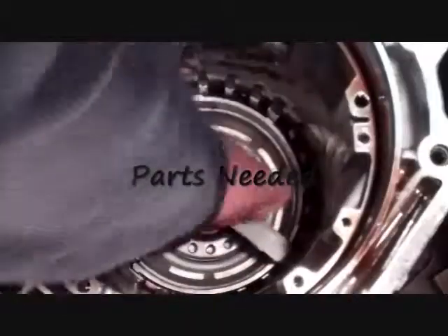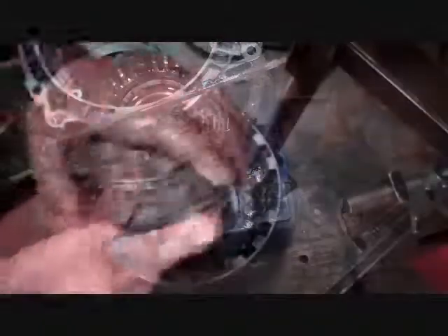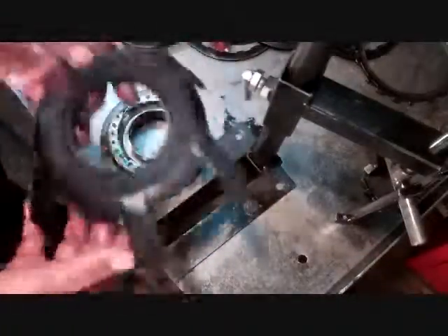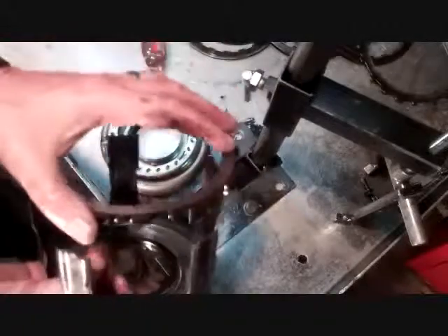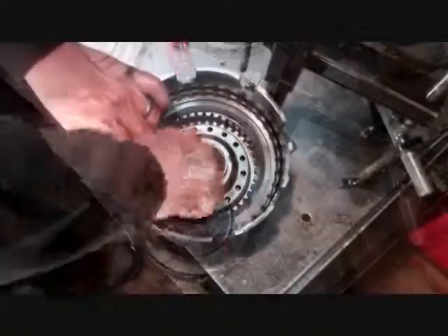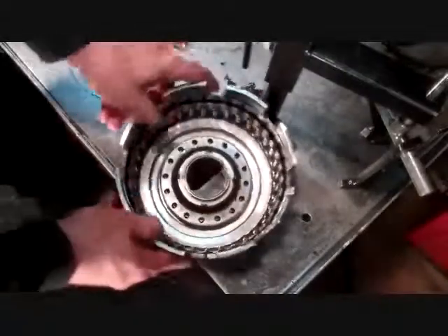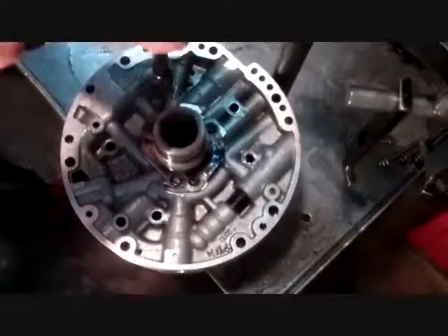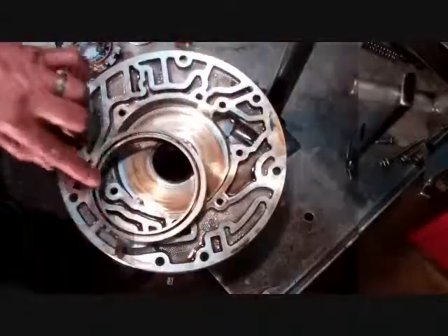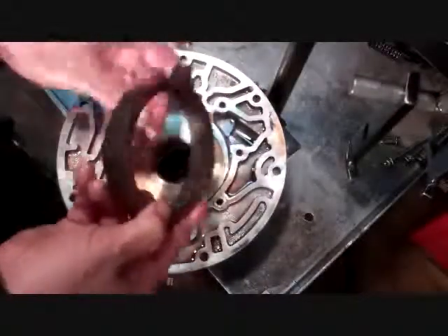Spacer plug. Compression tool. Got one on the inside of the groove, got one on the clutch — holds one way, turns the other, locks the other. This cage is what sits on the pin at the bottom of the drum. These notches actually sit on that. With the seals off, it'll drop right in. Spring goes either way — just dab it in, raise it up, just pop it out. Retainer out of this drum, just like we did the input. You hop the other bolt out, remove the spring. Pick it up — and there's a rubber seal inside of that; it kind of cushions down to keep pressuring. See the wear on the race.